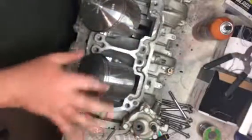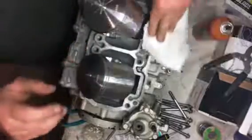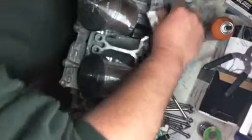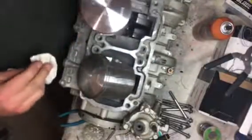Just a little in the cup — not much — give it something until the oil pump lines are bled and everything gets lubricated. Piston rings are on, we're good. Now I'm going to put the cylinder back on. Put the base gasket on the jug — just use your fingers, you don't need a ring compressor. Just squeeze your rings together with your fingers because the end of the cylinder is chamfered; it does have a starter lip on it.